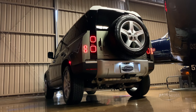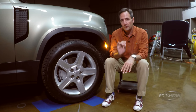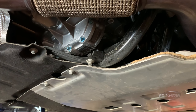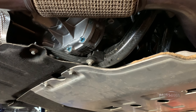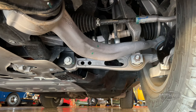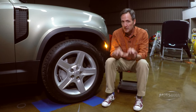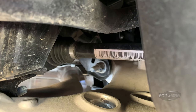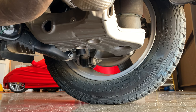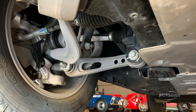And now to the heart of the matter underneath the vehicle, which brings us to the elephant in the room — permanent four-wheel drive. Notice I don't say all-wheel drive. Why? Because there is both a center locking differential as well as an active locking rear differential. That is backed up by double wishbones in the front and a multi-link unit in the rear, which in turn are attached to completely new steel subframes. Giving you a brief glimpse into what that means off-road: the suspension can articulate almost 20 inches, and the vehicle can attack inclines up to 45 degrees.